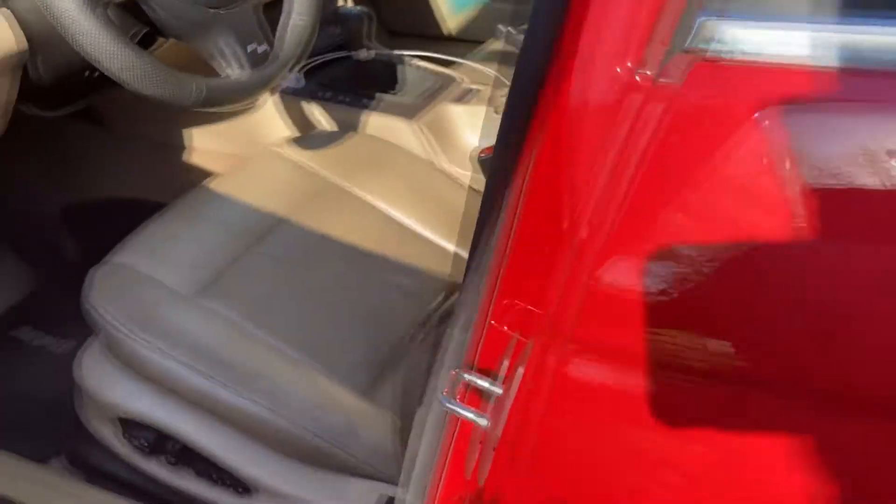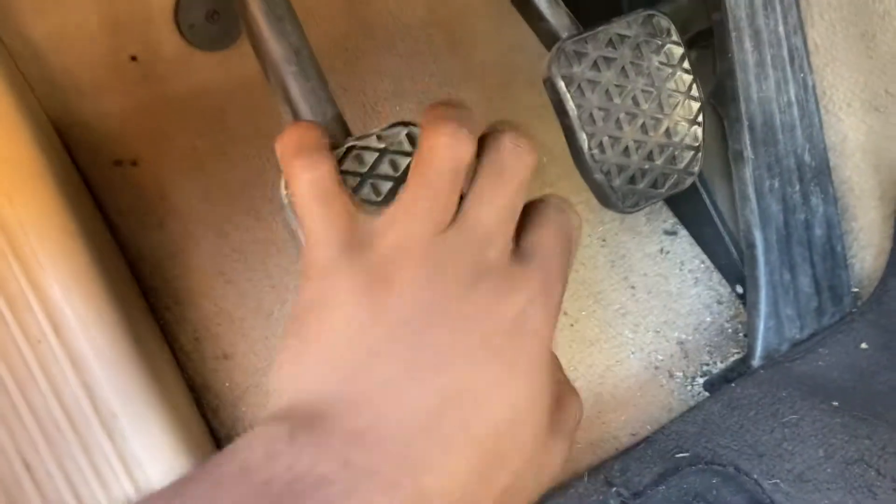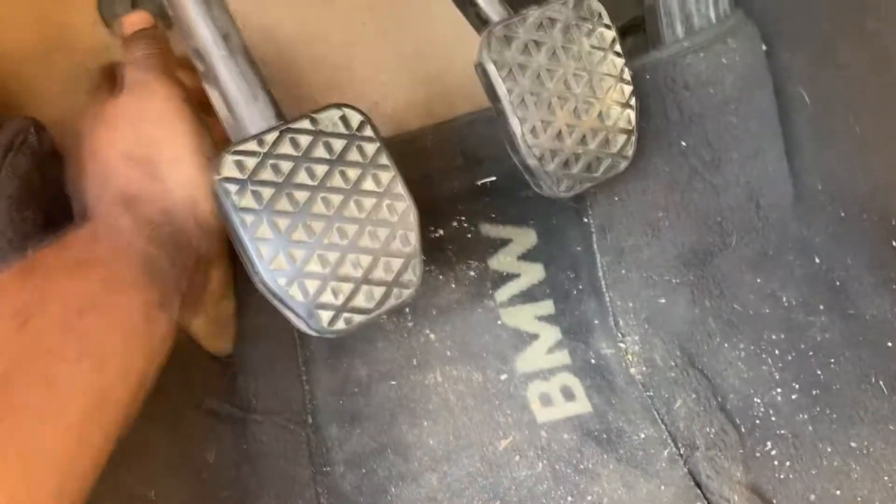Go inside the car and check your pedal pressure — make sure it's nice and stiff. The brakes are good, but the clutch is not, so we may have air in the clutch. The brakes are good though. Looks like we had a slight issue with the clutch.